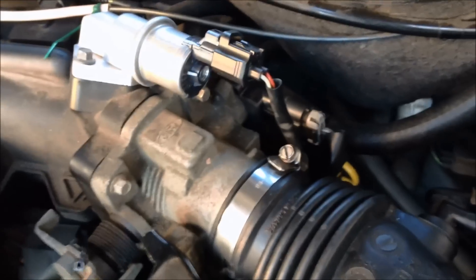It's held in by two screws back here, and they're too tight to even use a tool back there. You really have no room — I can't even fit that back there — so what you have to do is take the throttle body cover off.